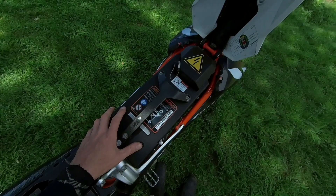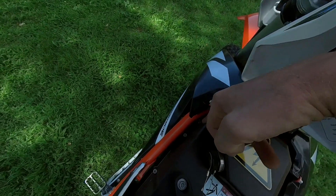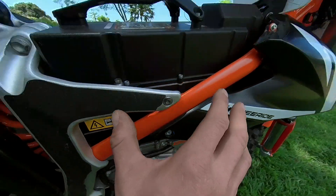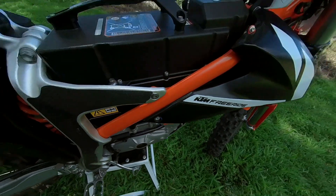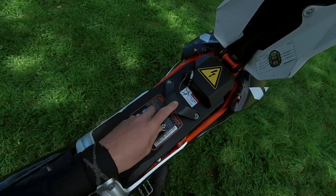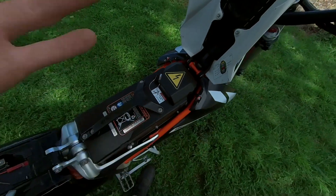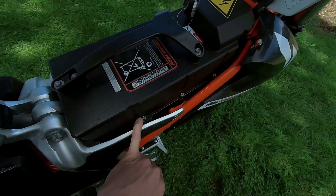Moving back to the battery — I don't have wrenches to take it out, but I'll show you how it works. You have these 10-millimeter nuts, really long nuts, and really long studs that come up from this platform on the bottom. You have a 63-pound battery sitting on top of this platform, on top of what we'll call the transmission. The studs are very long so it's fairly easy to get in and out — you might bang it on the frame a bit, but you can just drop it in. These are tightened down with 10-millimeter bolts.